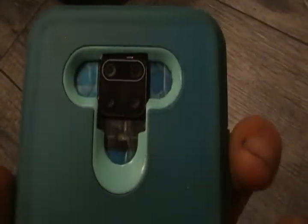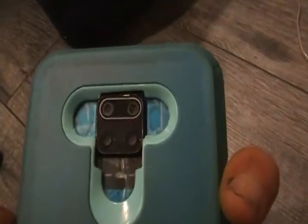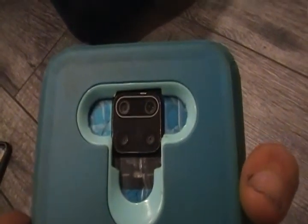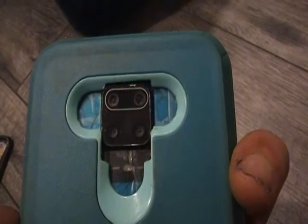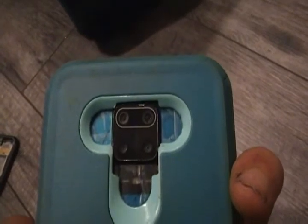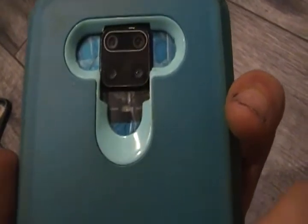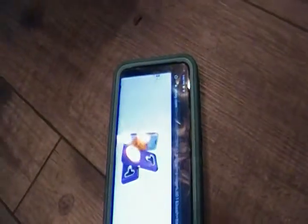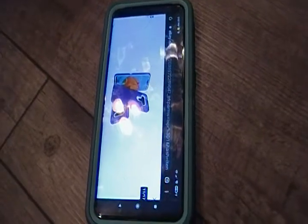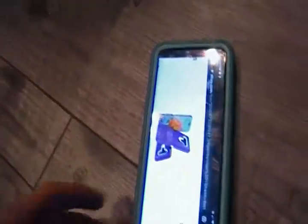You'll need to indicate the center-most part and grind however much off the width — about half the width on each side where the camera would be — for about a tenth of an inch. This case won't have an actual rubber inlay where it makes contact with the phone, so you could put a piece of paper or something in there to keep it from shaking around.